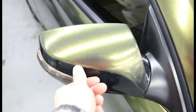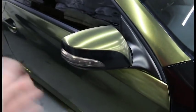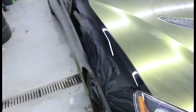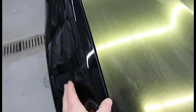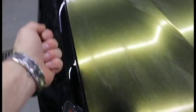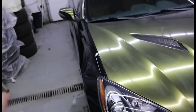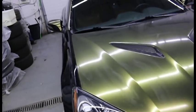Even with leaving very minimal wrap around the edges, there's no lifting. You can see there's no lifting because if we don't add tension to the edge, there should never be any lifting — even with water and rain hitting it all the time. I removed the fender just to see if I was going to be leaving any adhesive behind. There's a little bit of adhesive on the edge here; it just rubs off. That's because I pulled against the edge as opposed to pulling it off the edge. If we pull the vinyl across the edge, it will tend to pull adhesive off or leave adhesive behind simply because there's too much stress on the edge.